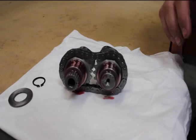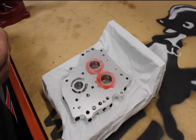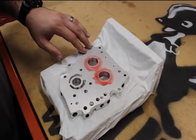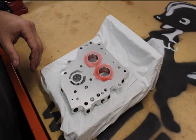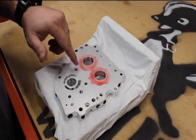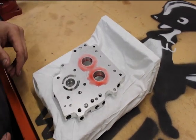This allows us to upgrade to all the latest and greatest as far as the twin cam cam support plates go. Since the conversion camshaft uses an 07 and later style outer cam journal, you'll notice that we're using an 07 and later style cam plate. Just like our cams, we already have this pre-lubricated — our bores and also the inner thrust surface here is lubed up and we have everything ready to go for install.